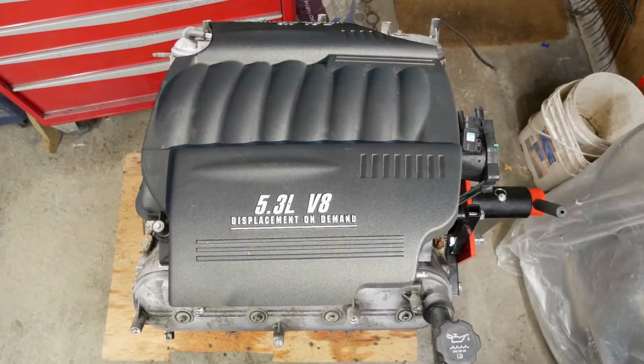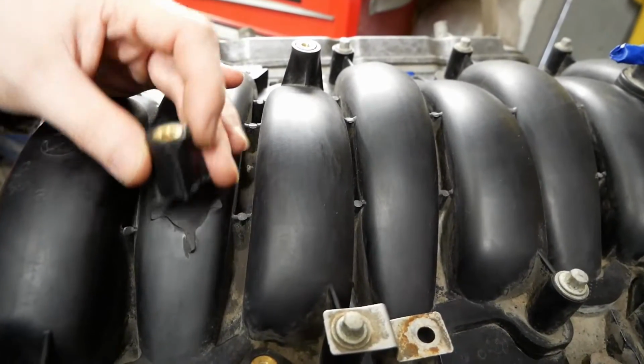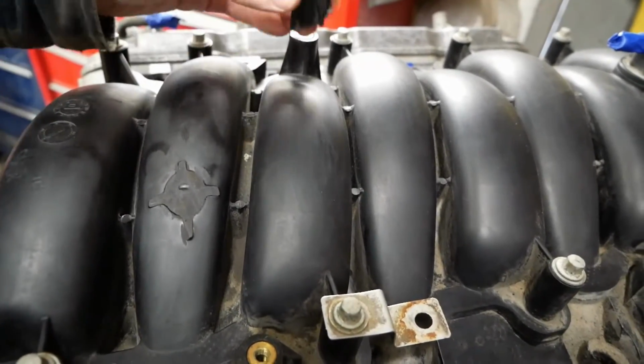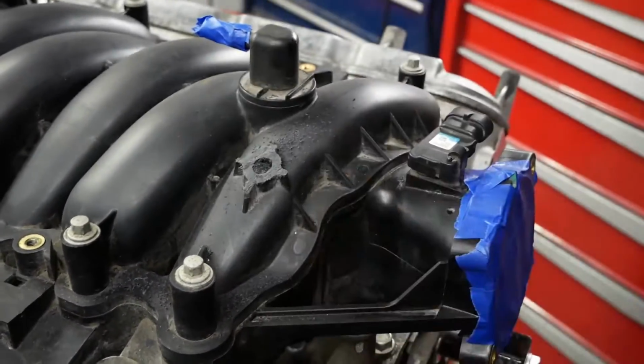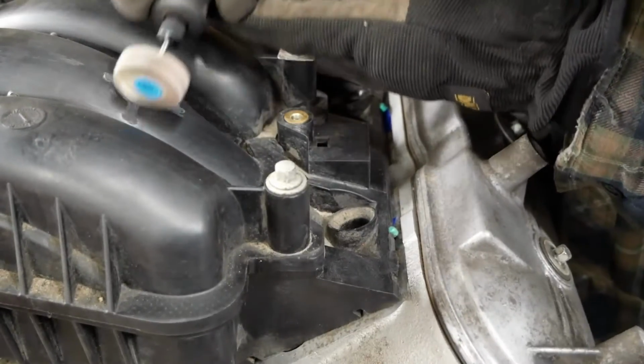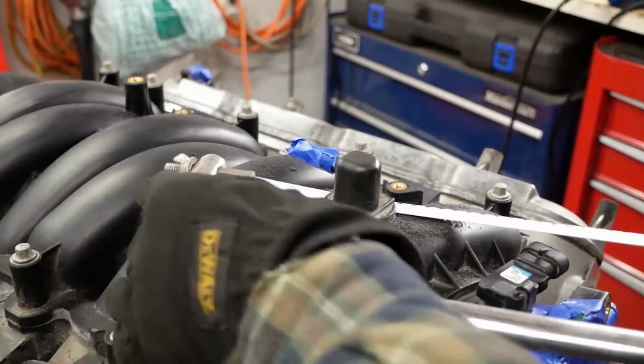It usually has a plastic cover over it, but we're not going to use that, so we can do away with all these large and ugly mounting bosses to gain back a bit more height. A hacksaw takes off the brunt, and a rotary tool helps smooth out the rest. This rather large breather is part of the PCV system, and it too had to go.